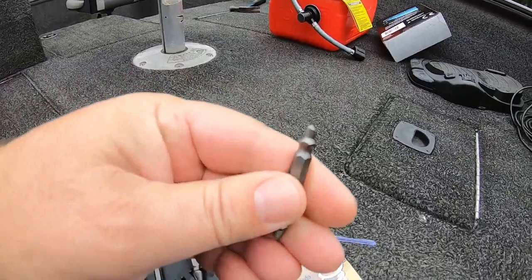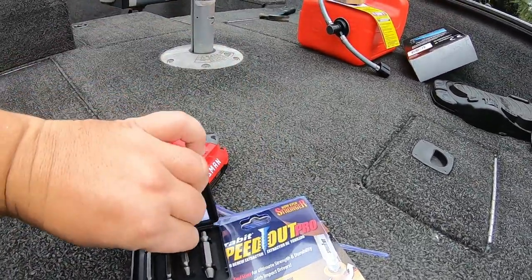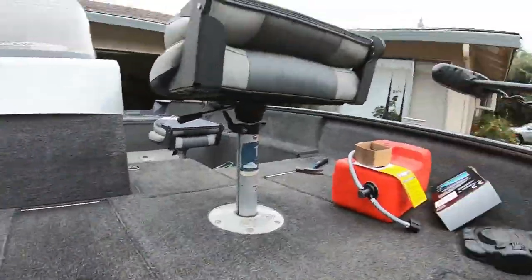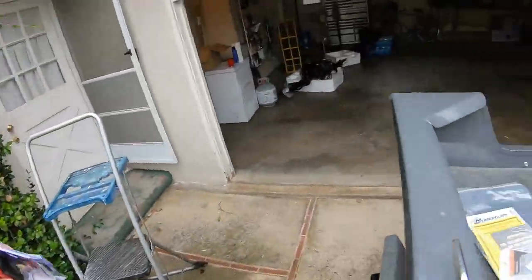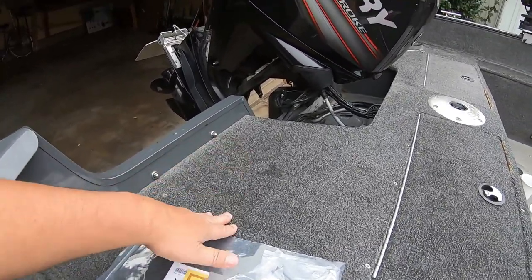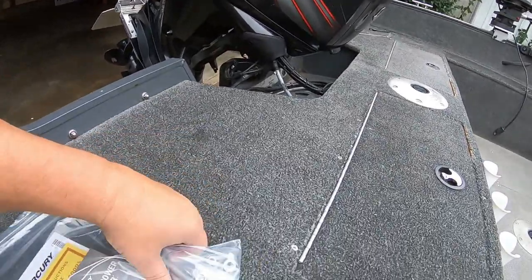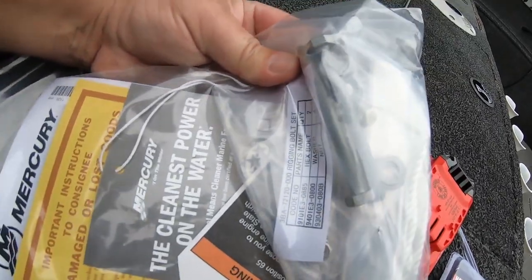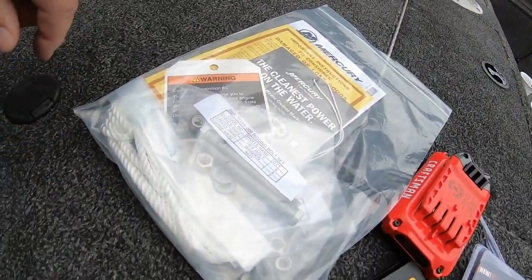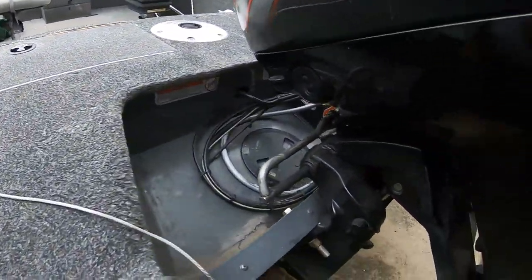You hit the screw with the drill bit end, then flip it over and reverse with your drill — it reverses out as it grips the screw. When I replace the screws I have to drill out, that's one difficult point — the stripped screws. Once I get the deck completely removed, I learned from this side there's a lot of foam to dig out. Get the board off, dig out the foam, start positioning your motor, and drill for the long bolts that come with the kit. Use stainless only.